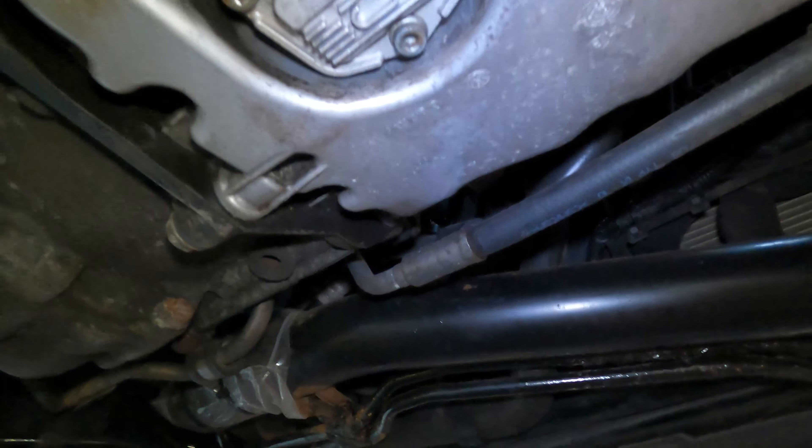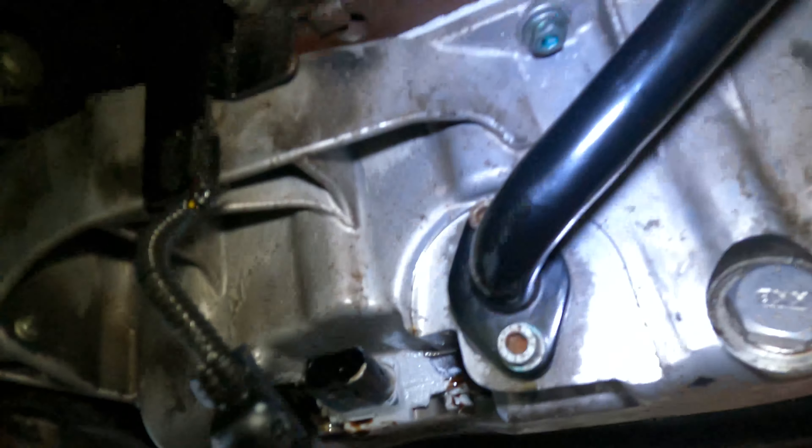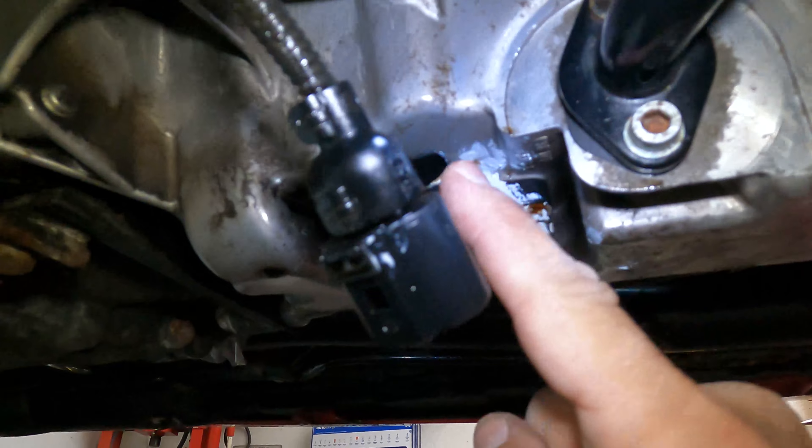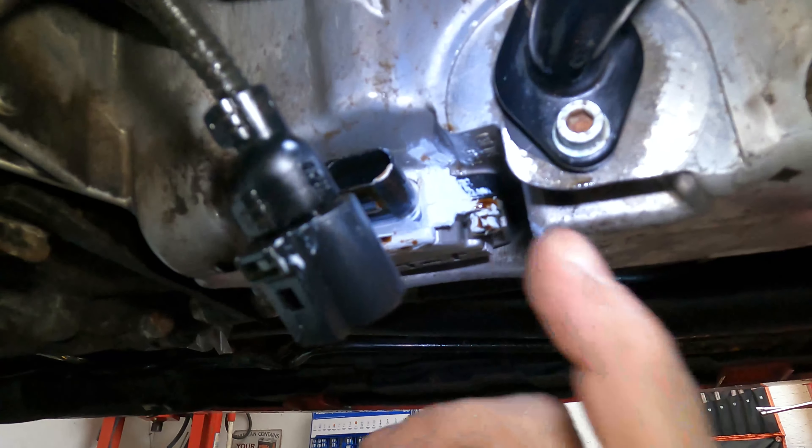As you can see, the oil is coming from the sensor where it's leaking — all through the electrical connector. There's no oil coming down from the top of the engine, so it is definitely all coming through that electrical connector. So what we need to do is remove the sump plug and the oil filter. Let's crack on and start sorting this car out.